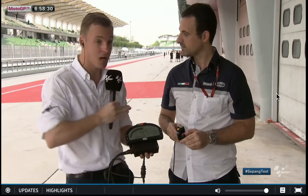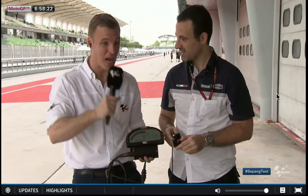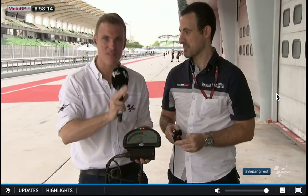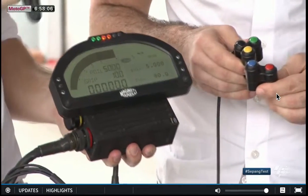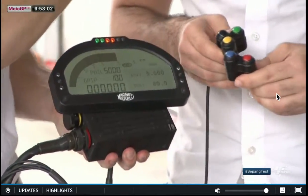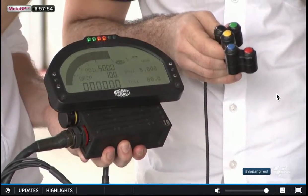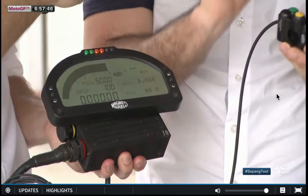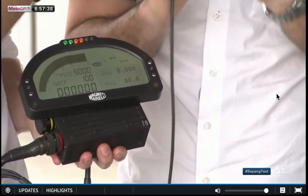Some special information can also include alarms. I think what will be nice for our viewers is to first talk about what the main strategies actually are, just in case anyone hasn't heard of them before, and then you can actually change them for us and show the motions the riders have to go through when going absolutely flat out on track. So please bear this in mind — the demonstration we're doing now is something the riders will have to do going as fast as they possibly can. So Vicente, let's start off with anti-wheelie — they're getting on the gas and the bike just wants to go skywards. Anti-wheelie is one of the many strategies in the bike which understands when the bike is pitching up and wheeling, which is undesired, and cuts a bit of power in order to bring the front wheel back to the ground, even if the rider is at 100%. So the rider can concentrate on trajectories and doesn't need to be playing with the gas on the limit. The electronics can help him do that.